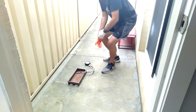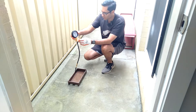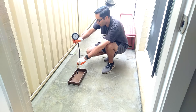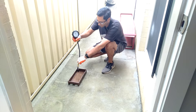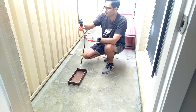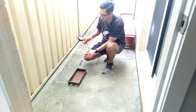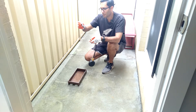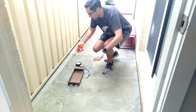Before you pack the gauge away, I'll just show you something you need to do. If you hold it up and then press that release valve, you're going to get some fluid dripping out — do that until everything drains out. Just hold down that release valve and that'll make sure everything gets drained. I would recommend leaving it on the bench somewhere safe just for any remaining fuel to evaporate. Then disconnect this piece and put it back into the kit.